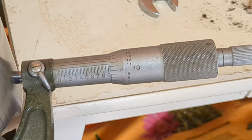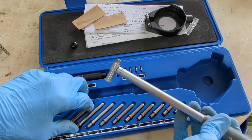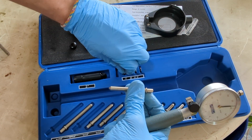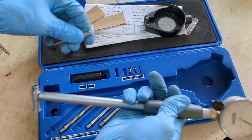The line is halfway to the 12, so the final reading is 3.9365 inches or 99.9871 millimeters. These pistons are all part of Tolerance Group 1, so that number is within spec. Now I am setting up the dial bore gauge to measure the inside of the cylinders. I am using a 3.8 inch rod and a 0.12 inch extension to get close to the diameter of the piston.